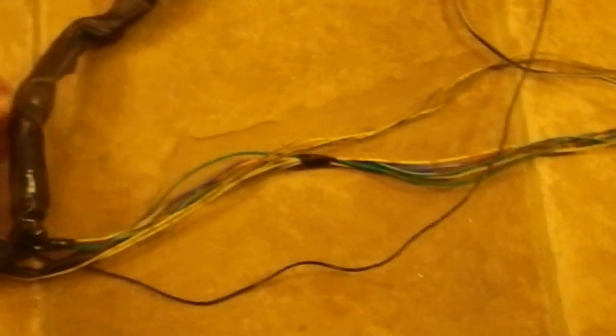I tagged them and cut every wire that wasn't part of this series — there are about 53 of them. You need to get all these diagrams; I have them in my link on post number 46, and they're absolutely essential to do this. From here you find out what you need. The wires lead to connections you'll be keeping: this connection goes to the circuit opening relay, and this one is the EFI main relay. Those are the only two relays you'll need off of the FJ62.